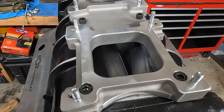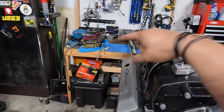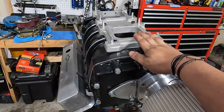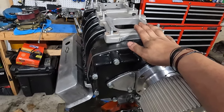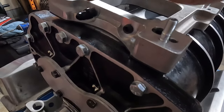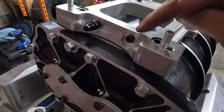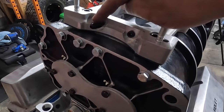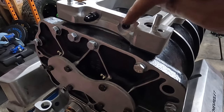Oh yeah, gotta love that. So obviously I went with the duals, the Snipers, we'll grab them in just a second. But again, this is another choice you need to make on this type of induction and type of fueling that you're going to do. On the back of here, there are two ports. I have another 1/8 MPT to 4AN, and I have this one plugged. But these ones are always going to see vacuum. So I'm going to run the transmission vacuum modulator to this port here with a 4AN line. And if I need another vacuum only, it's going to be right here.